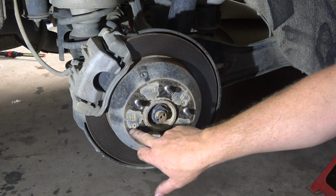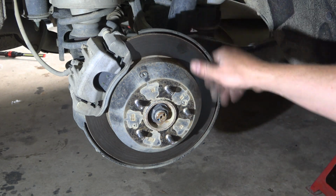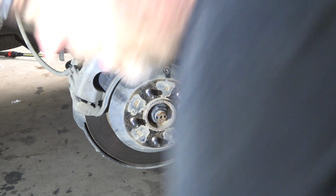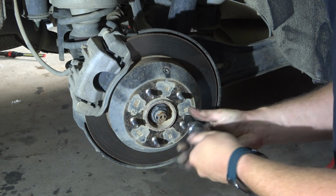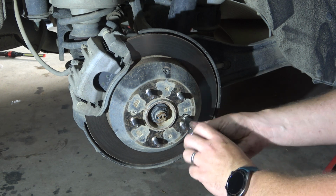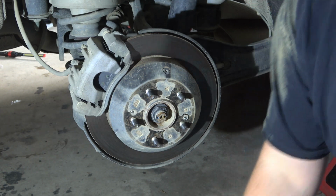First thing I do is, there's these two screws that hold the rotor on. Just gonna get those loose once everything's together, helps it come apart. So I'll just put the handbrake back on. So handbrake's on, impact driver. You see how tight they are. Oh, we can actually undo them by hand, which is good. So this one, I'll loosen them. Crack them loose, job done.